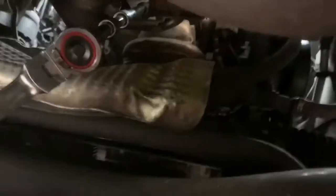Okay, we are out here under the Promaster and I wanted to make a quick video about how to do the cat — the rear cat specifically. The front cat is easy. I'm under the van and instead of trying to get to the cat from where it is right there, you're best off to come back here by the muffler and attack the two 10 millimeter bolts. You can see that I'm on one there, and the other one at the top of the cat — that's the oxygen sensor. With a long extension you can get to those two cat bolts.